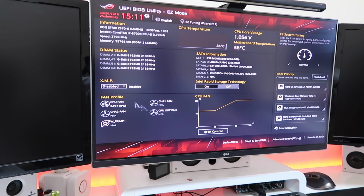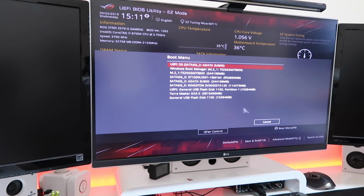If you are using another system, then just search on the web and you will find a lot of tips that you can do to change your BIOS settings. Now after that we will reboot our computer and get into the BIOS settings so that we can choose the USB drive as the boot drive.